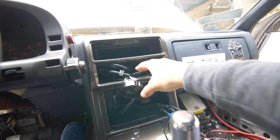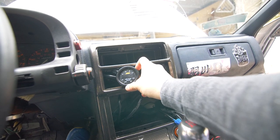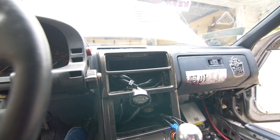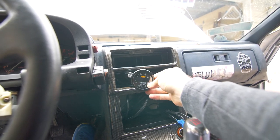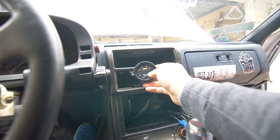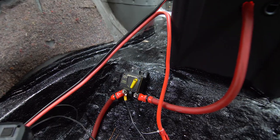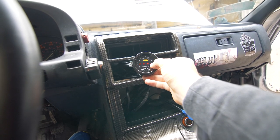I'm still weighing on a DIN mount panel for some gauges, but until then we're just going to leave this here and make sure it works. Obviously I can't start the car because I deleted the MAF, but I can switch the ignition so the gauge gets power. It should read at the very top of its range since the sensor is just in free air right now. And as you can see, the sensor is completely maxed out — which is exactly what we expected.